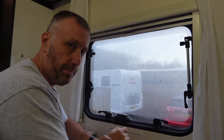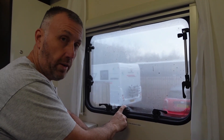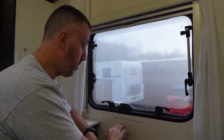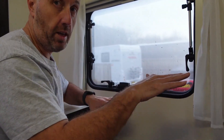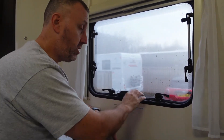If you've got the heating on set to gas and you open this particular window — this is the only window in the whole motorhome with the Truma switch on it, because the flue is outside. Opening it will knock the heating off so there's no chance of gases blowing back into the van and gassing you. There is a warning on it. All the other windows are fine, just this one.